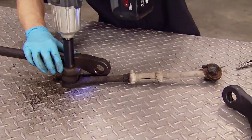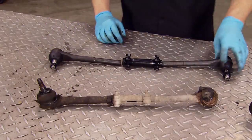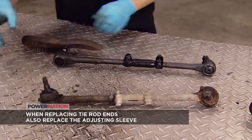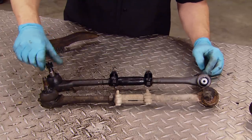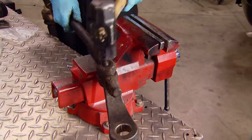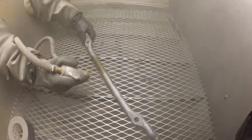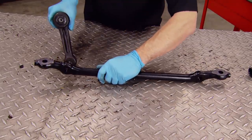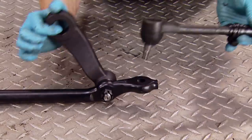The ketchup-schmutz covering the joints actually helps with teardown because it stops things from rusting, so this actually came apart pretty easily. Your goal here is to mock up the tie rod to approximately the same length as the original. We're using a new adjustment sleeve because they're inexpensive and it makes it easier. Exposing the threads helps you dial in the length and will help you in aligning your truck once it's on the ground. You may need to use a little persuasion to get the idler and the Pitman arm out of the main center link. After a bath in the parts washer, the blast cabinet really cleans up the center link and allows for a coat of paint. From there, your idler and Pitman arm just get bolted in place and the rest of the assembly mocked up, ready for reinstallation.